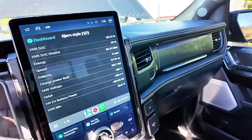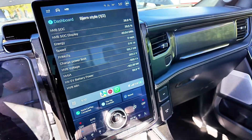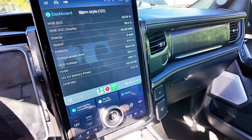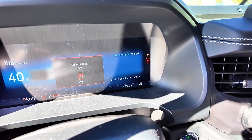Check this out — you can see the high voltage battery is drawing 500 amps at the initial plug-in, which is about 5 to 10 minutes normal for the Lightning. Not all EVs do this, but here I am drawing 500 amps. I'm looking for no lower than 170, closer to 180 to 190 kilowatts ideally. And as we look on the screen, we are charging at 183 kilowatts. That tells us this adapter is charging exactly like the original Ford and Tesla adapter did, with no losses. We'll let this run through the 500 amp draw, which is where you'll have maximum heat and maximum kilowatts, then check the temperature again.